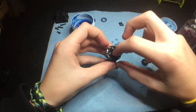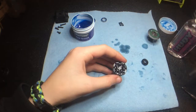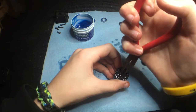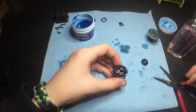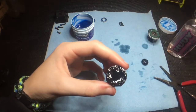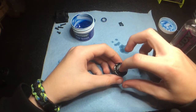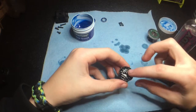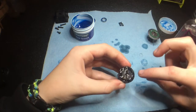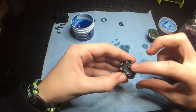This is when I'll set the spider gears in. Take my pliers and push them out to the walls, push it down in, wiggle it, and make sure all the gears are lined up right so they're set in there. Then put the last gear right on top. Some oil will ooze out — move that excess oil into the side slots to fill those up. You don't want any air inside the diff.